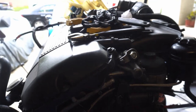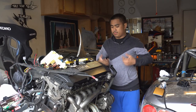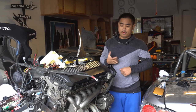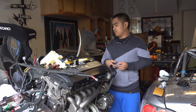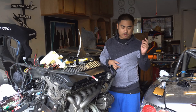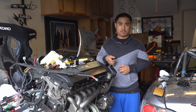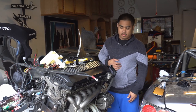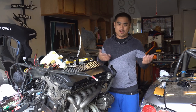I also changed the oil feed — instead I have it coming over from the front of the block. It's still nicely tucked and not noticeable, unlike some setups that run the line above the motor. That's pretty much my setup. I did the oil feed and return, the coolant feed, the turbo clock, and the exhaust manifold mounted. None of this is completely finalized — there's still a lot of work to do. I've got to do the oil pan baffle, clean out all the AN lines since I used an angle grinder, and sort out all the gaskets. It's the stuff I don't find interesting so I'll do it off camera.